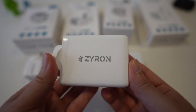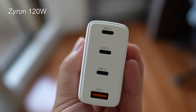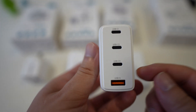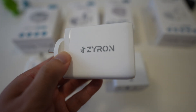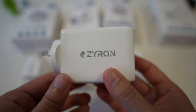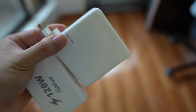And finally, we have the largest charger that Xyron makes — the PowerStone 120. This one has a maximum output of 120 watts combined. It has four ports: C1, C2, C3, and a USB-A. The USB-A will obviously have less power than the USB-C ports, but the combined output is 120 watts. This could charge gaming laptops that use 100 watts via USB-C, or the most powerful MacBook Pro 16-inch. Gaming laptops from Asus or MSI will happily charge off this as well. If you have a lower power laptop, you can probably charge two or three of them at the same time.